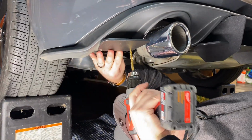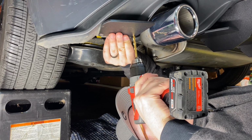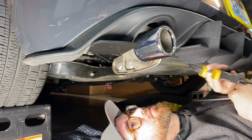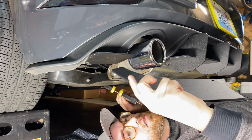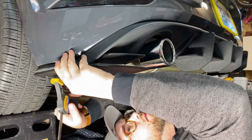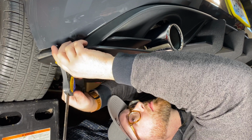And once you get that other bolt in there, you're going to go ahead and drill the next hole. Now we're gonna get the larger spat, or lower spat, kind of in place. We're using a squeeze clamp to hold on the end that is closest to the tire. It makes it really easy just to kind of adjust it, especially if you're doing this as a one-person job.